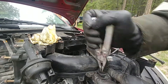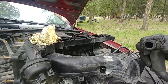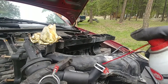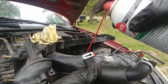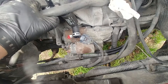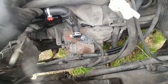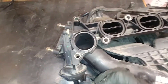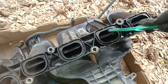Time to remove and clean the cylinder head where the manifold will be placed. Remove the metal hose clamp and remove the old PCV hose. Even if the hose looks okay, replace it — it's about a ten-dollar part. It takes time to get to it, and if it's cracked you'll have vacuum leaks, rough throttle response, and a rough idle. Remove all the gaskets and clean the manifold ports using brake cleaner and a toothbrush.